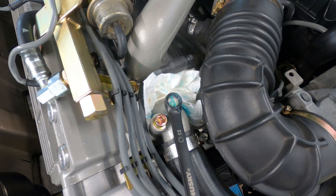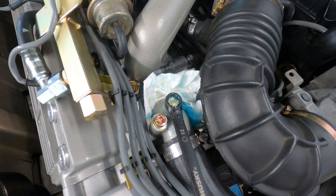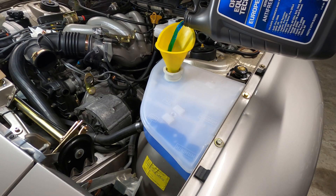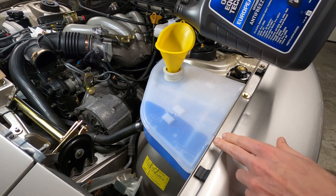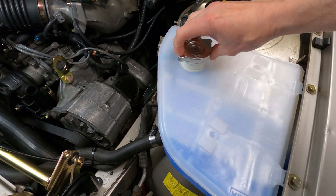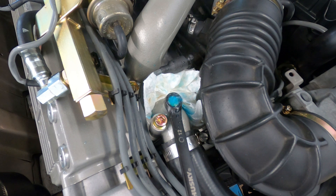Go ahead and turn off the engine and vent the system at the venting bolt. Catch any coolant that escapes, and you may need to run the engine for two to three more heat cycles to fully bleed all the air out. As you continue to vent the system and remove the air pockets, go ahead and check the fluid level at the coolant expansion tank. If it's fallen below the minimum level, you may need to add some more coolant and top it up. Continue the venting process until no more air escapes from the venting valve, and then the car will be ready for normal operation.